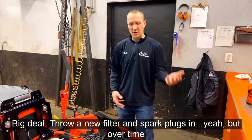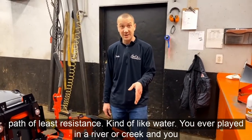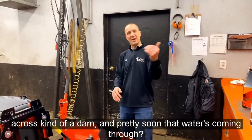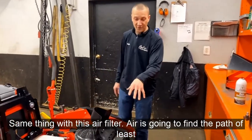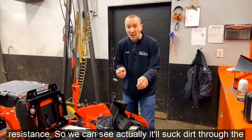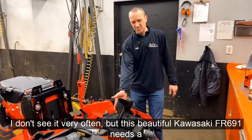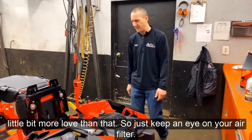Yeah, but over time you do that, and air is always gonna find the path of least resistance, right? It's kind of like water. You ever played in a river or a creek and you built all these rocks across kind of a dam, and then pretty soon that water's coming through it, finds its spot, and then it gets more and more in that spot. Same thing with this air filter. Air is gonna find the path of least resistance. So what we can see, actually, it'll suck dirt through the paper, create a hole, and we're just sucking dirt in. We're killing an engine. I don't see it very often, but this beautiful Kawasaki FR691 needs a little bit more love than that. So just keep an eye on an air filter.